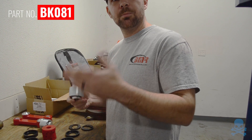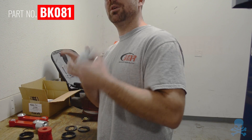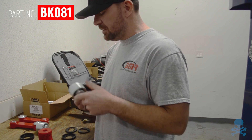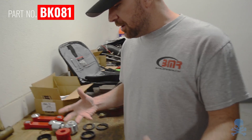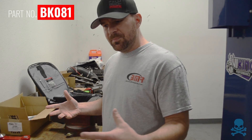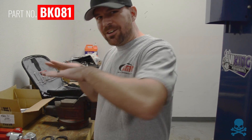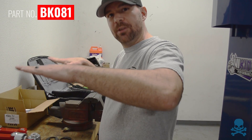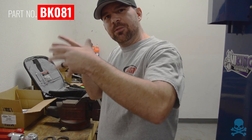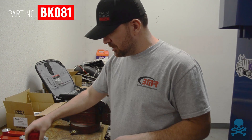You've got to take the wheels, the brakes, disconnect the half shaft and the knuckle, pull the arm out, press the bushing out, press the new one in, and put it all back together. It's a pretty tedious install — Colt's done it about 20 times. The theory is basically that in the IRS cradle, you have movement of the entire assembly that rocks. So first we want to address the cradle not moving, then we address the differential that moves inside the cradle.